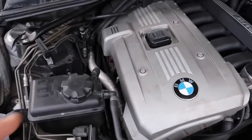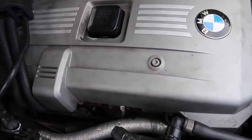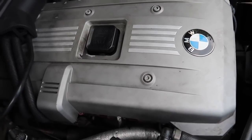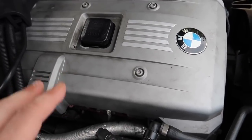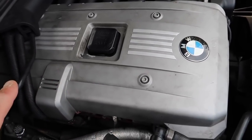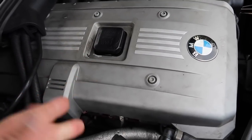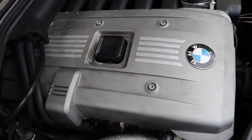The first thing: when you remove the plastic cover, you've got your ignition coils underneath. The ignition coils on these do like to go out. On most cars they throw a code, but on BMW they'll leave you running in limp mode and not even throw a code until you push it on wide open throttle under heavy load. My best advice is to switch them around to see which one's failing, but if they haven't all been changed before, replace all six — and replace all six spark plugs at the same time.